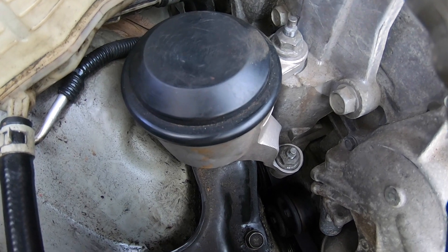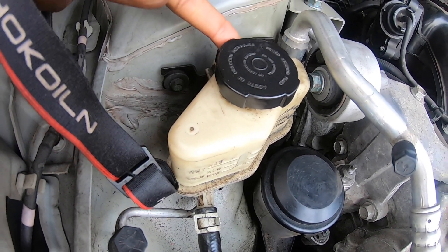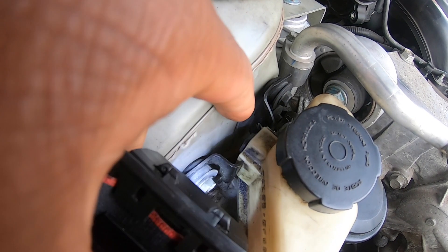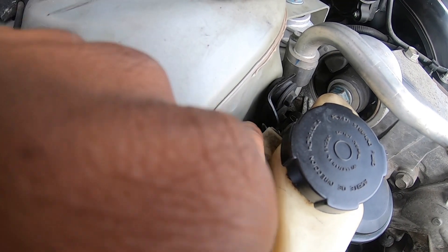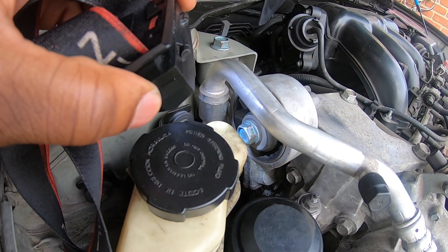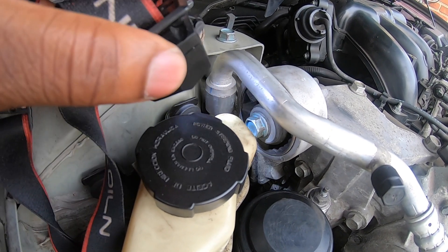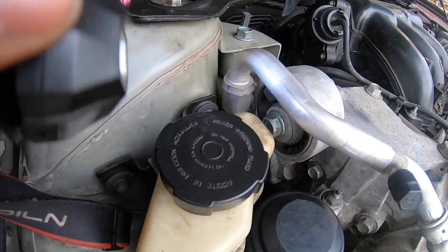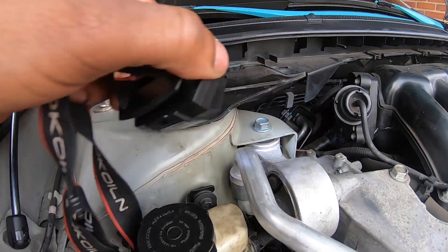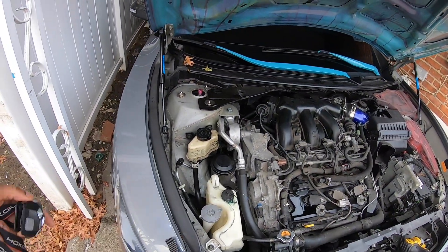You also have to move the power steering reservoir. Get a flat head and put it right behind the clip — pry the clip out towards the body of the car, then pull it up and it should come right out. This screw you have to take out completely — it's an 18 millimeter. You can use a spanner or a socket with an extension and ratchet. To get this loose and give the engine more play to move, take out the bolt fully. After that it should be it, and the same process to put it back in.